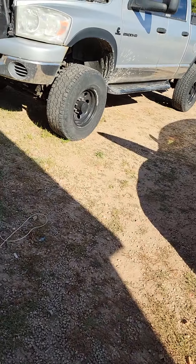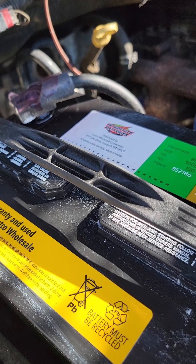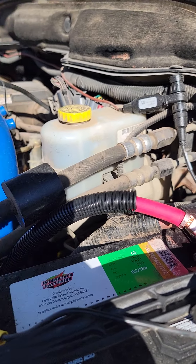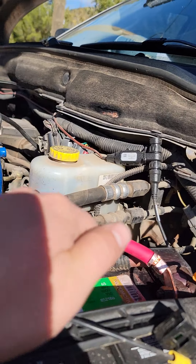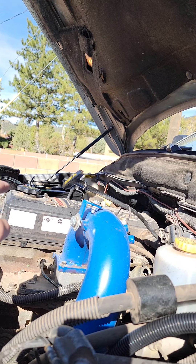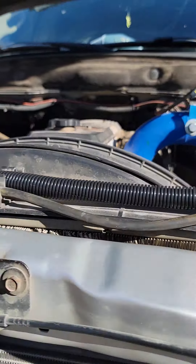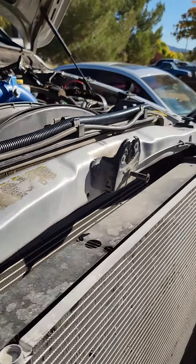Basically what was happening — we're thinking it was bad — it was giving me a high voltage out of the alternator and it blew this battery up. So I had to go get a new battery on this side, and this side wasn't really charging that much at all. That's why on these trucks the voltage indicator, battery temperature, computer and everything runs off of this battery. That other battery's only job is basically for the alternator to charge it. The cable between them — this crossover cable — is very important. If that's bad, you're going to have issues. Like I said in a previous video, replace your batteries if you're getting pedal codes.